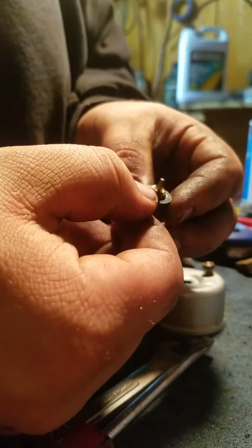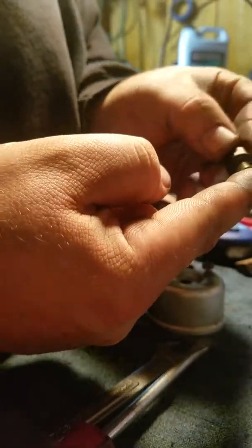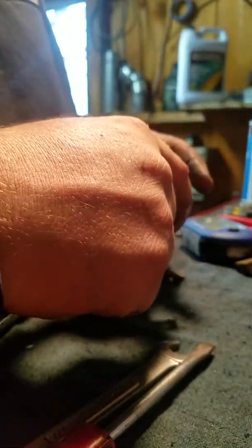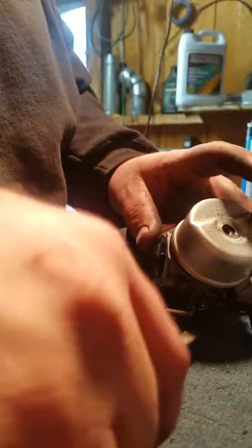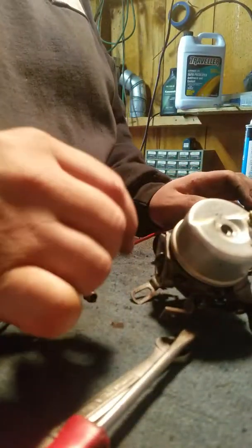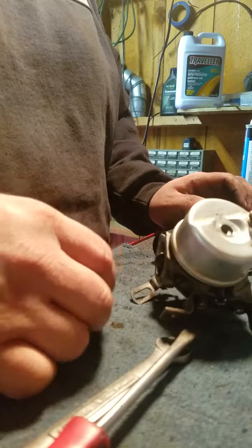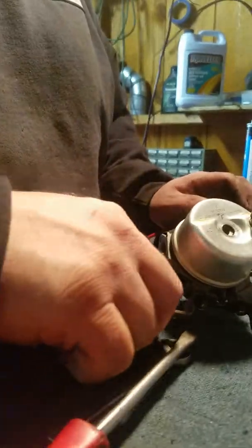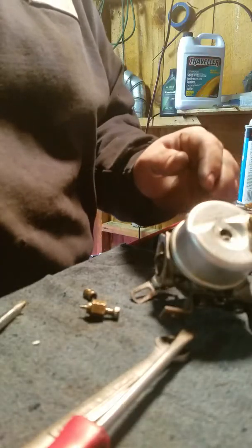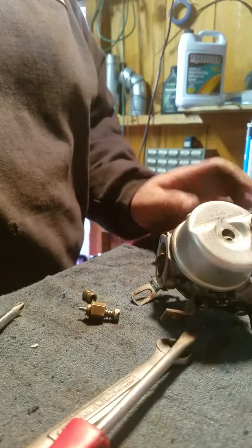You can see here — this piece is supposed to go in here. You can see where it broke. There's nothing holding it on this side, just that one little bit on this side where it's nice and shiny. Nothing really shiny on this side — tells you it was already partially broken. You can't really see it when it's in the threads, you know — and then boop. I'll have to bring that down to the garage and look for our parts. But that's all on that carburetor — I'll fix this and get it back running. I'll come back with a video on hopefully it running. I just wanted to show you how to clean a carburetor the cheap way without having to buy gaskets and having to bring it to somebody.